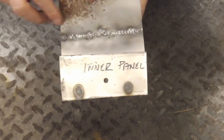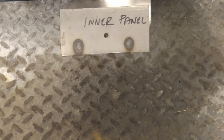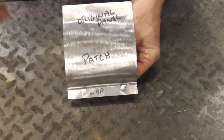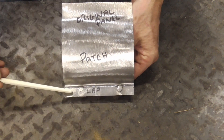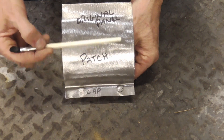You'll always have an inner panel — on a hood, door, quarter, rocker — there's always an inner panel and you'll find drains in there. Then you'll have the outer panel, and in dealing with the outer panel you're going to have a lap weld that you must do, or a lap joint or some type of pinch weld, and then the patch.